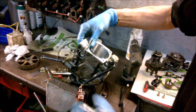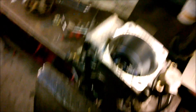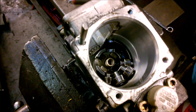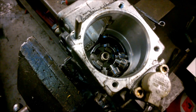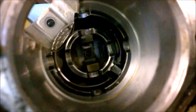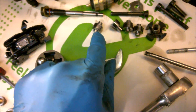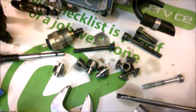Now, the rest of your pump — you can see the rollers are in there, all the rollers and everything are everywhere. It's not really the end of the world. Just get a pair of long nose pliers or your fingers and get them out of there. So the rollers are removed. All you've got now is basically your roller cage in there that needs coming out. You can see the centre shaft spinning. You have your little driver for the rest of the pump, your little spring that's got to go in, and then your rollers. The rollers have got like a little concave washer on — they've got to face the outside of the pump.